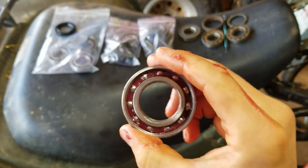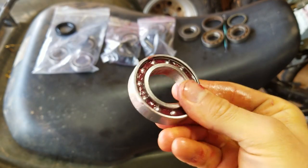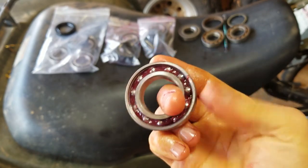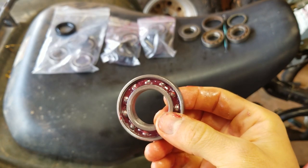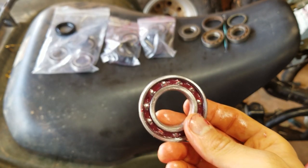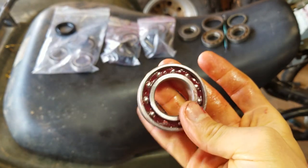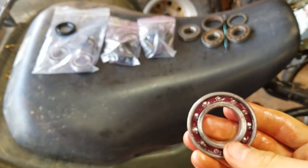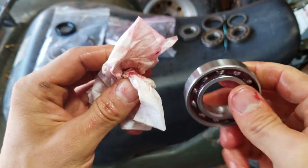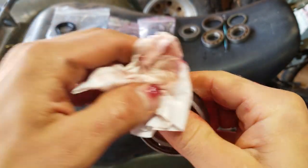That feels pretty good — it's not busting out the seams, it's pretty full. For an electric motor that little amount of grease makes sense, but I haven't calculated the wheel RPMs and I'm not interested in doing that — it's a four-wheeler. Just put more grease in the wheel bearings; they don't put enough in. Most of that stuff washes out anyway, and if you pack them full, it prevents water from getting in. Don't go crazy with it, just put more in.